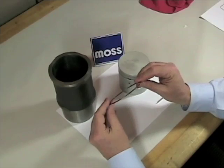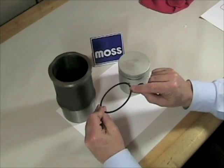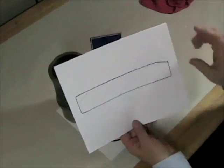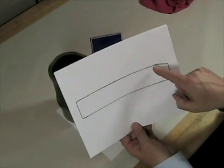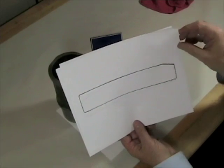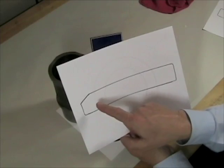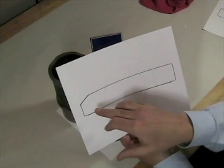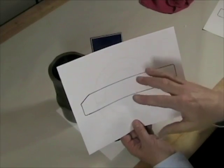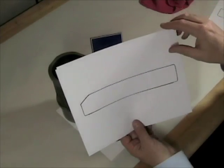I'd like to point out something to you. Imagine in your mind's eye that you can see this cutaway edge of this ring, but much bigger — it would look something like this. If you'll notice, everything is fine except there's a bevel cut in the outer edge at the top. Or you may look at it and find that you have a bevel cut at the outer edge on the other side. If there's a bevel in either one of them — in other words, if you don't have four square corners — the instructions that come with the rings are going to tell you which way this has to go and which groove it goes in.